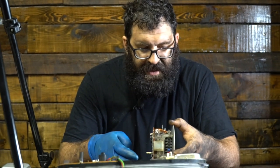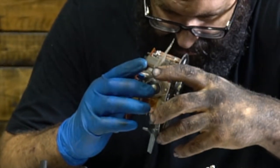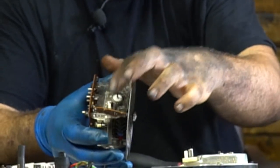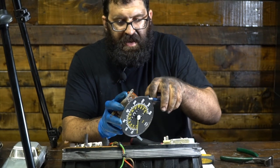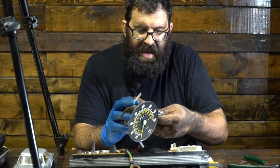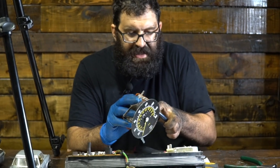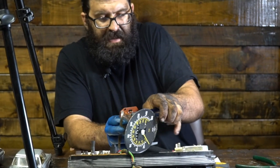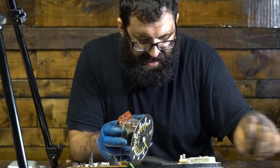So let's make sense of this mess. First thing we've got to do is get the remnants of this little gear off. If you have a car that's from a hot climate, certain parts can get absolutely cooked. This is not a straightforward, easy odometer gear replacement. To get this off, because it's got a little copper shunt in it, you've got to squeeze it with some dikes so the thing slides off.